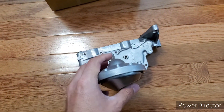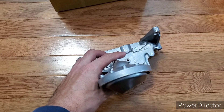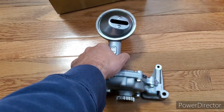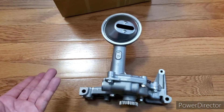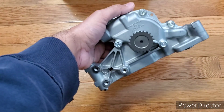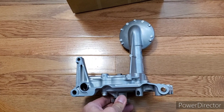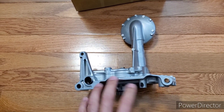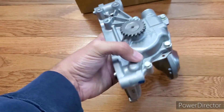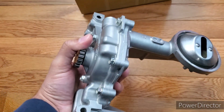Most of this stuff as far as stamping goes, you can't fully rely on some of those details — but if you have the real one, it should have everything I'm talking about. Also, if you end up with a fake one, the gear may have some play going up and down and in and out. You don't want any of that — it can cause big issues to your engine if your oil pump goes bad.